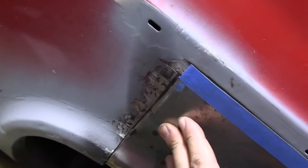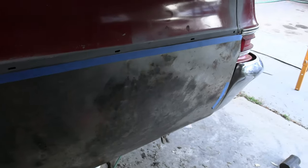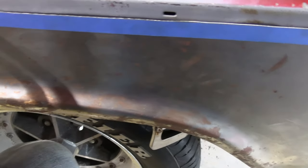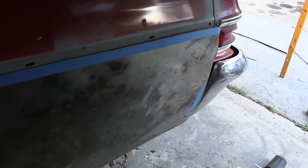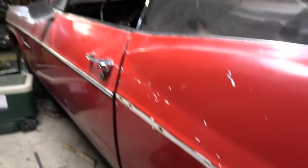This is what I was talking about — they did a pretty sketchy cut on there, but we'll figure it out. I've got to take her back off and move my tape down a little bit. I'm using a sanding pad and sanding down to the tape — that gives me a good straight edge so I'm not wavy and don't go farther than I want. It's just a process: grind it, fit it, grind it, fit it. You can always take off, you can't add on.